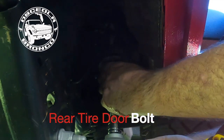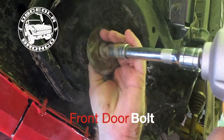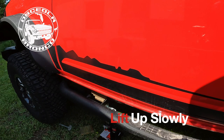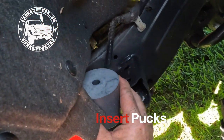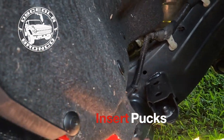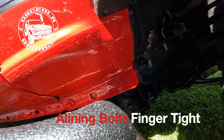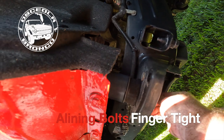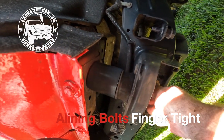Keep in mind, you've got to keep a check on other things other than just the body and the frame. You need to make sure that ground wire is not getting caught on anything, as well as you're not putting too much of a bind on the brake lines, as I mentioned before. Here I'm inserting the pucks on the passenger side, rear 3 mount points. Once the bolts were inserted and the threads were started and finger tight, I lowered the jack, repositioned it further to the front, and then raised it up again so that I could gain access to the front mount point